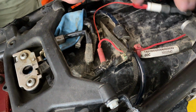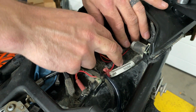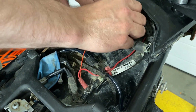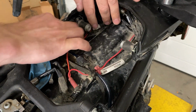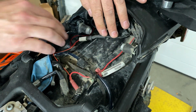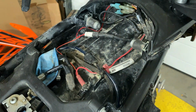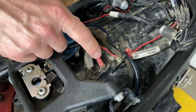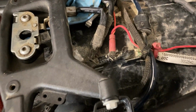So what that ends up doing is illuminating the B6 all the time using the keyed power, and whenever I actually use the brake pedal, it gets extra bright using the signal wire. These posi taps work really well. I've already got my multifunction turn signals teed in using the same posi tap, and it's still working good.